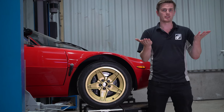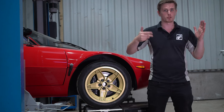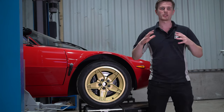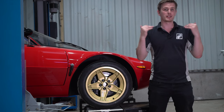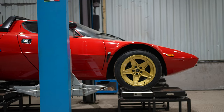Equally on the driven wheels - on this rear-wheel-drive car, if you had 100 kilos difference at the rear tires, one tire would tend to spin up, which would be the lighter wheel. That can really play with the diff and give traction issues. So if we have those contact patches as even as possible - down to within a kilo of each other - then it has even levels of grip and traction.